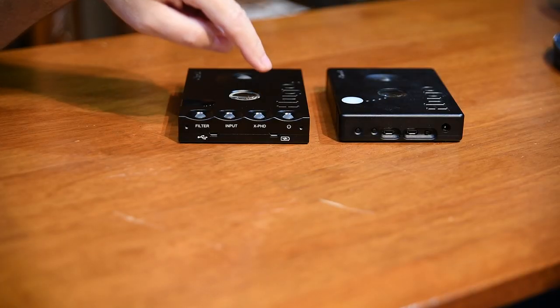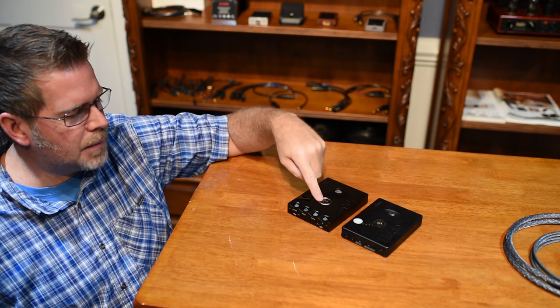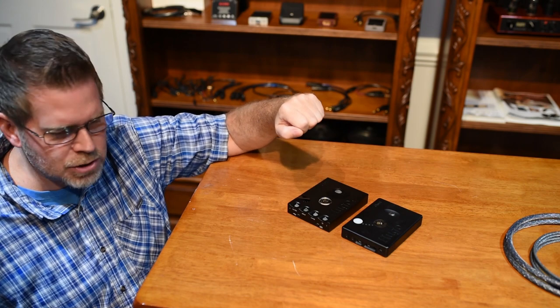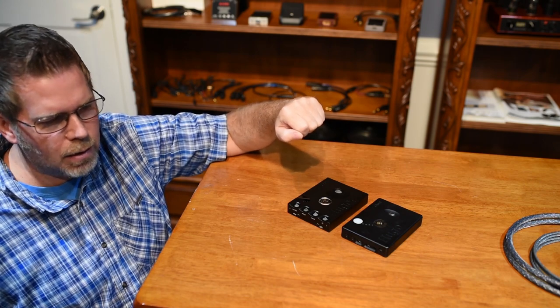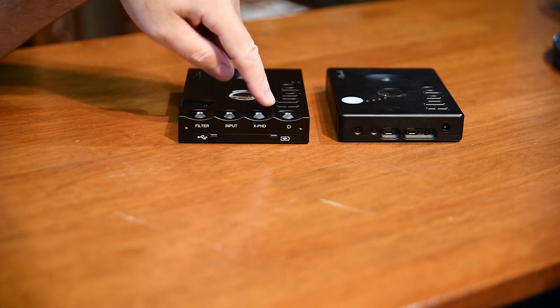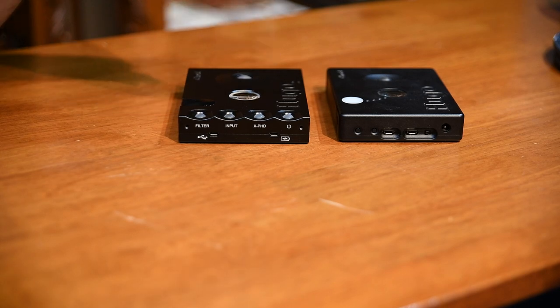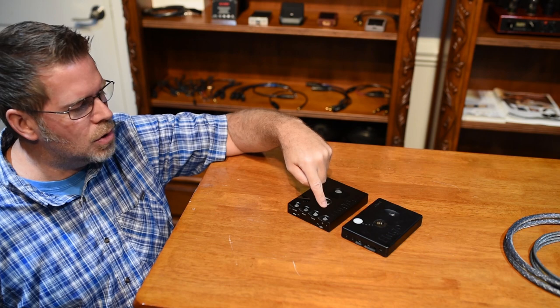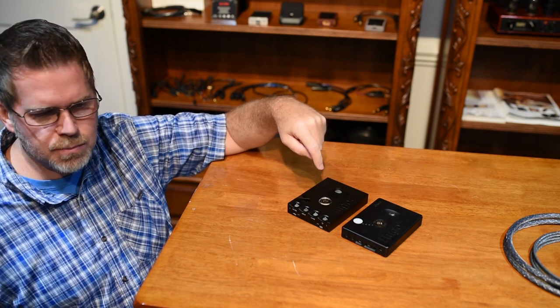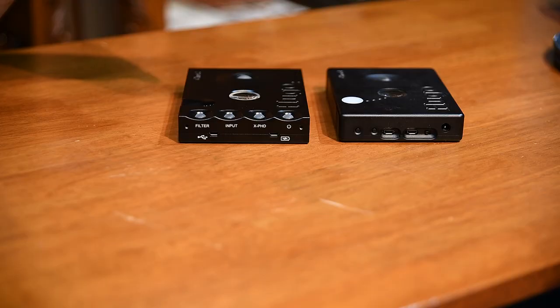Hugo 2 has switched to a different 5-volt USB charger wall wart. I would highly recommend, as we've talked about with the Mojo, that you have a USB charger that's at least 2 amps or higher. Never use your computer to try and charge a device like this — it only outputs about 1 amp and it'll take forever. Make sure your charger says at least 2 amps and 5 volts. A standard iPhone charger isn't going to do it at less than 1 amp. I recommend the Tronsmart at 3 amps, or check your drawer of phone chargers for a 2-amp one.